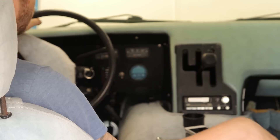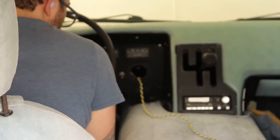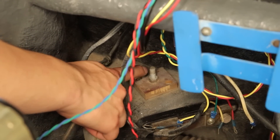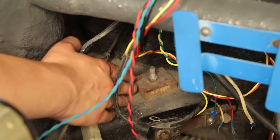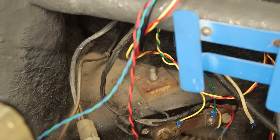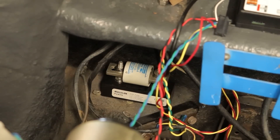Now I'm moving to the inside of the car where I'm replacing the main battery monitoring unit with my new display, because the old battery monitoring unit never worked and this will be much better for actual usability. Down in here is where you would normally hook up the positive batteries, but in the stock battery pack the fuse was in the pack, so I'm installing a fuse right here instead to support my new pack.